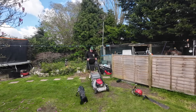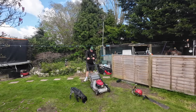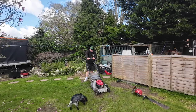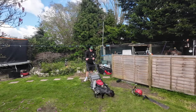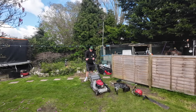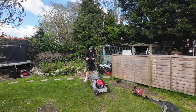I might have to get my man Mendit Man and see if he hasn't got a spare guard for one of those Honda gearboxes, because they do rot out, and that's why they have problems. But the rollers feel really, really loose. So hopefully the rollers come apart on that, and if they do, then I can put the new clutch in, no problem at all. New clutch in, button it all up, new bearings, all singing, all dancing.